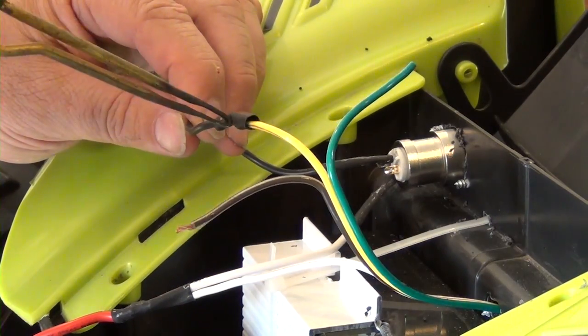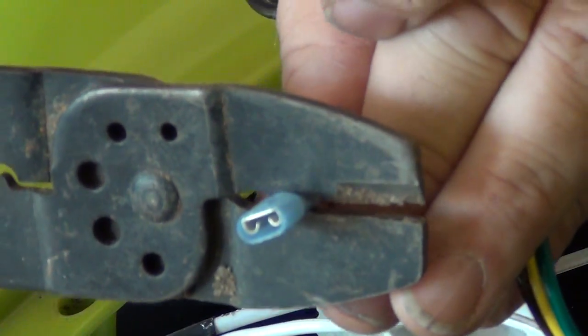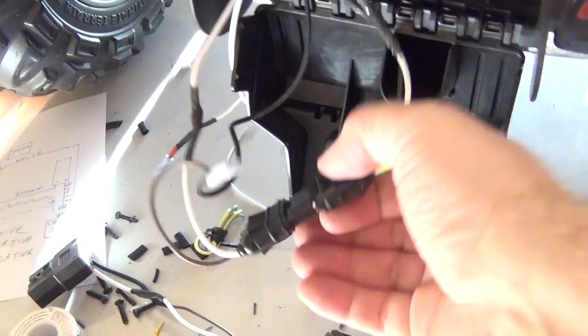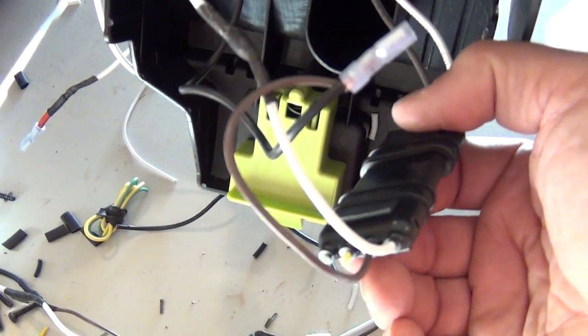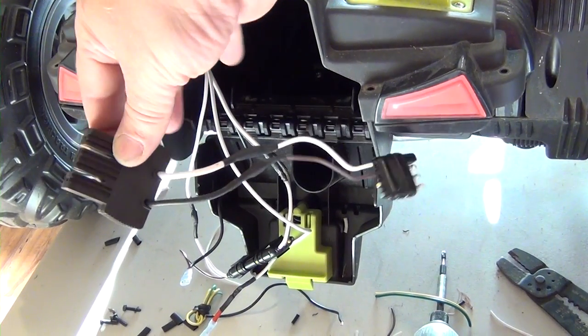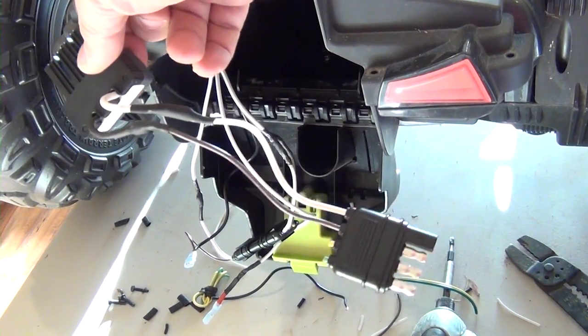The batteries required four 1/4-inch F2 connectors that simply crimped onto the wiring harness. Here's a shot of the new and old wiring running through the center channel of my Dune Racer. I purchased 4-wire trailer connectors, but as it turned out, I only used 2 of the wires. This is the pigtail that I made up for those occasions when I want to use the stock 12-volt Power Wheels battery. No additional wiring is required, but I have to use the original charger with that battery.